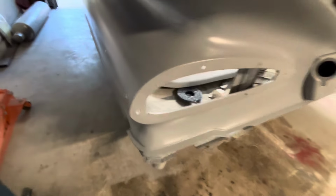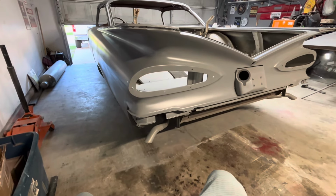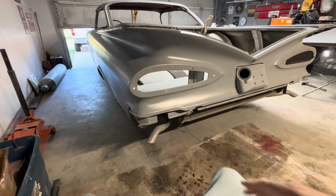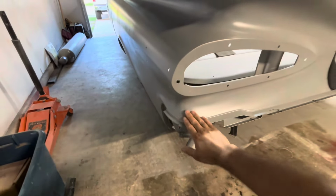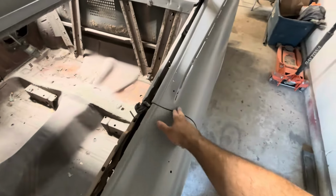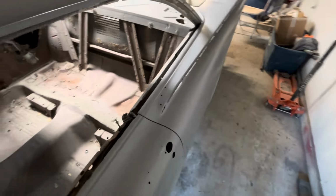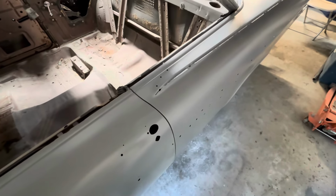A lot of new stuff that I didn't know. This is my first time doing body work on a '59, and my goal was to get this thing into bare metal and epoxy, without realizing that these edges here, this edge right here, up here, right here where the quarter panel meets, this little area, they're full of lead. So when you're going ham with the blue disc trying to get the paint off, try to avoid these areas, because what they did is,